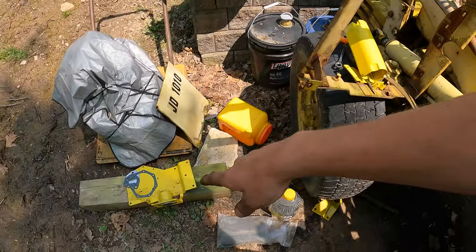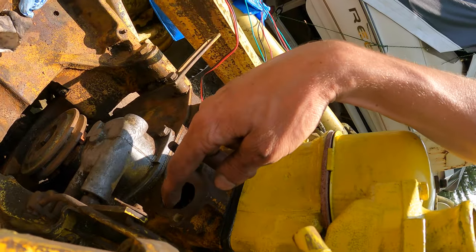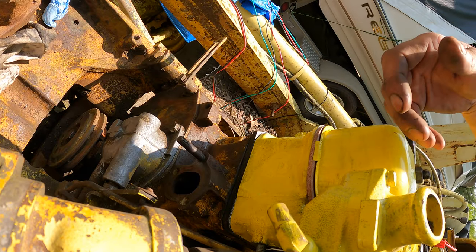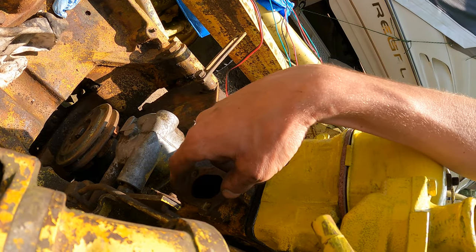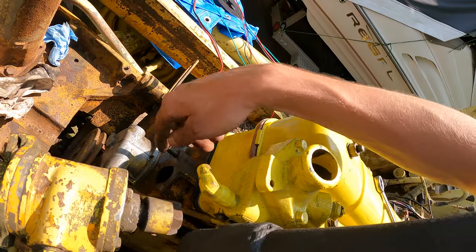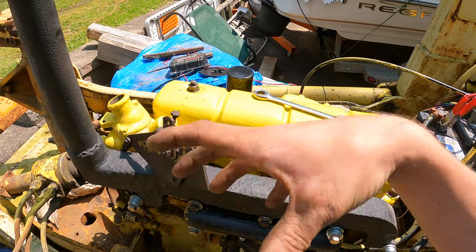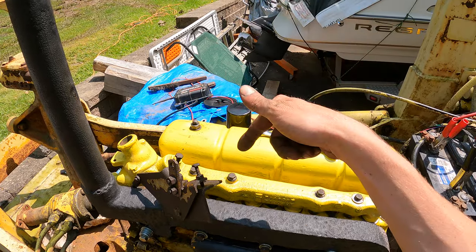So I got my water pump here. It goes on here. Got to blow these holes out. They have ant stuff in them. The one thing I didn't like, and I just wanted to document this, was when I was just running it, I was getting blow-by out of this hole, some oil. There's a chance that's residual, like it's heating up on the outside of the cylinders. I had oil on it and burning off, or I don't have a good seal on the water.